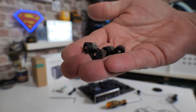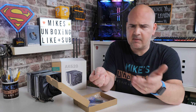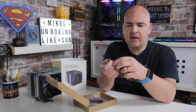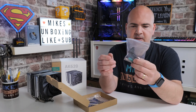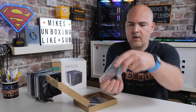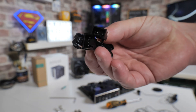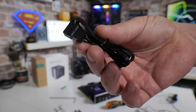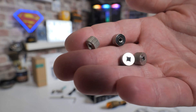Also in the AMD bag are four mounting screws, making use of the AM4 backplate — or AM3 backplate if you're on an AM3 system. There's a little bit of plastic to protect the motherboard when you screw it in, and you don't need any tools — you literally just tighten by hand. Next up is the multi-bag, which is a selection of parts that fits all. In there is some Deepcool thermal compound and a PWM splitter, which puts both fans into one header — handy if your motherboard only has one CPU fan header. You also get four thumb screws for attaching the brackets to the AM4 backplate.